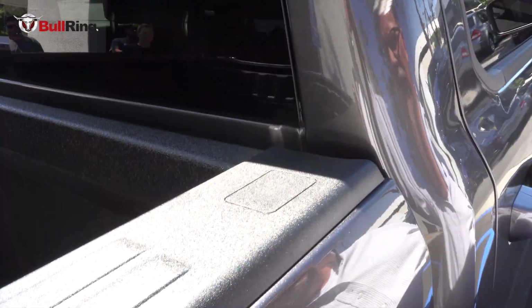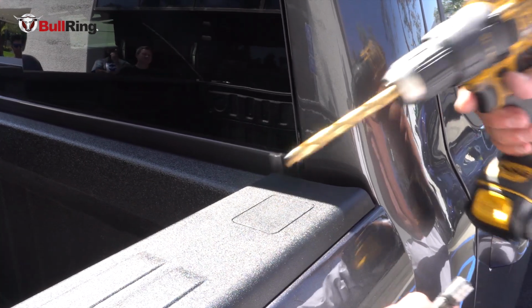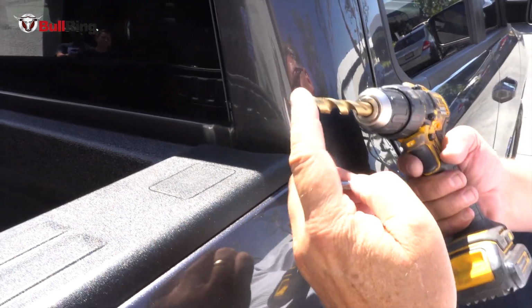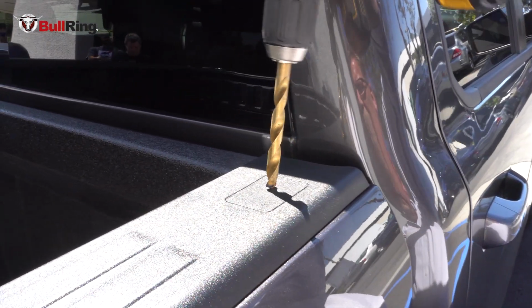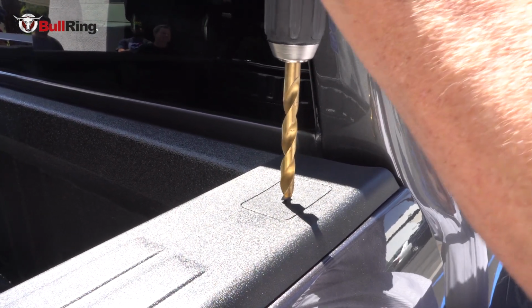The cleaning router that goes in that hole that we used back there, that goes around here and cleans out that opening, is just like this. So we need to have a starting place that's at least that big. So we have this amazingly big drill to give us a pilot hole to start with. So I'll drill that hole now.